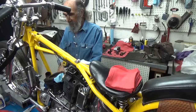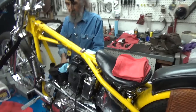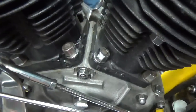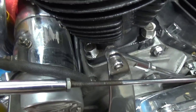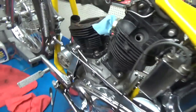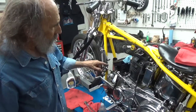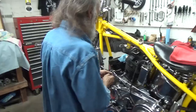When you know something is really adequately tight, then all the other fasteners that are doing the same job — you want to get them to the same torque. It's as important to make all that stuff match as anything else. That's what you really want. Torquing down a cylinder head — I may put these heads down to 65 pounds, but my accurate torque wrench is going to make sure they're all at exactly 65 pounds.